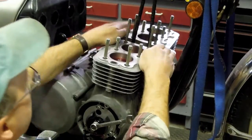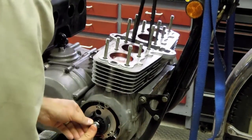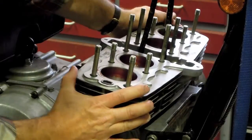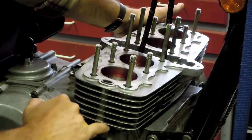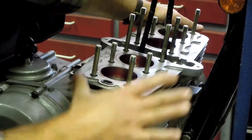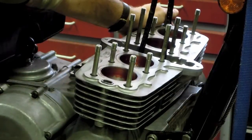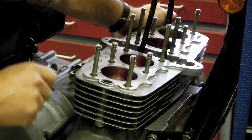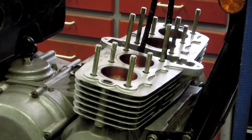At this point I've got all four pistons in the bore, so I'm in very good shape. At this stage I'm going to continue to rotate the block, which will force the rings up into the bore as you see happening here. I'm checking all four pistons as they go in. Now the base of the cylinders will drop right down into the bore in the mouth of the block. The block is down all the way — I had to wiggle it just a little bit. The oil passage orifices, one on each side, act as positioning guides, so a little wiggling gets it to set properly. It's now nice and tight. I'll wipe off the assembly lube from the top.